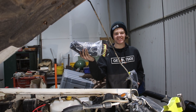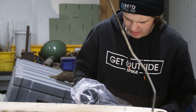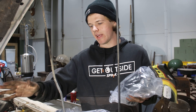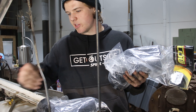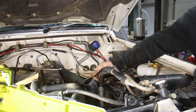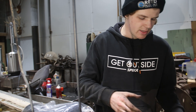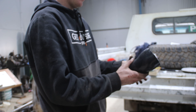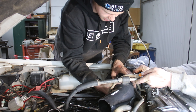Picked up some silicone joiners to get from the airbox to the turbo intake. I've got a 45-degree reducer from three-and-a-half inch to three inch — that was $66 — and a 90-degree from three inch to two-and-a-half inch — that was $37. Ideally you'd want the factory GU plastic piece that just clips in, but I've got to work with what I've got. I've diced up a bit of the end of the silicone joiner because we didn't need it as long as it was.